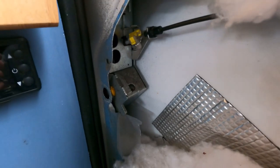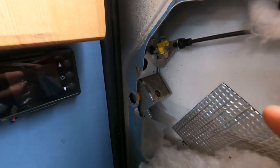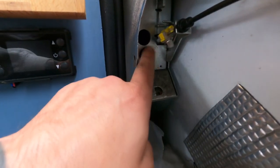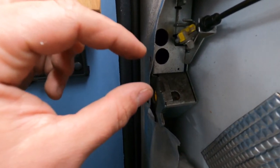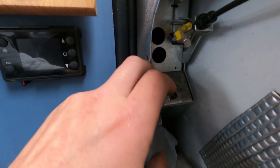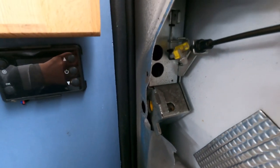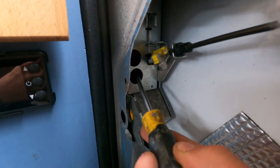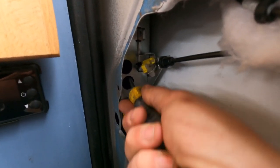This is the lock mechanism that is quite prone to breaking on the side loading doors of the Mark 6 and Mark 7 Transit Van. You will notice that yours does not have these two holes — these are aftermarket holes. You're going to need a metal core bit to cut yourself a good sized hole. Once you've cut one hole you should be able to put your screwdriver in and aim diagonally up until you can feel the latch, then pop the latch and open the door.